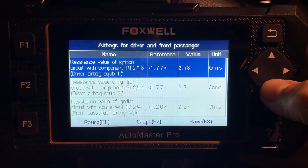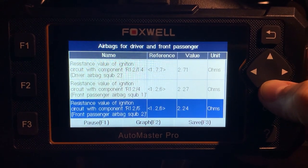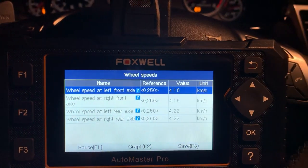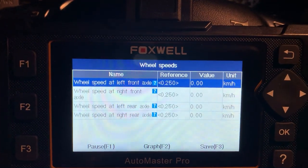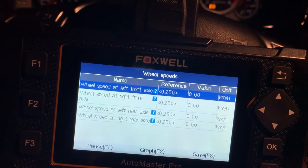You can also see the resistance value in the airbags. That's how the airbag control module determines if the airbag is connected — by resistance. When you snap the connector together it shorts them and provides resistance back to the module. If the resistance isn't in spec, it sets the light off. Same thing with wheel speeds — if wheel speeds aren't reading, you get the ESP or traction light, and you need to see if the wheel speeds are comparing to each other or if one is off or not reading at all.